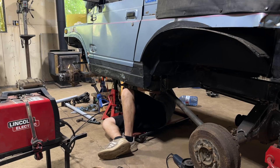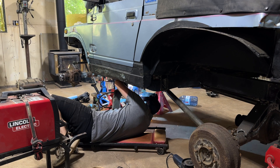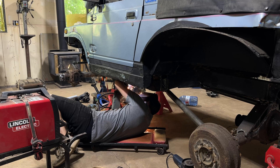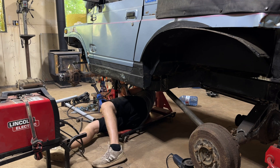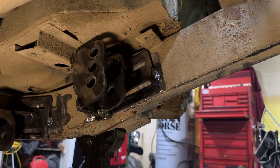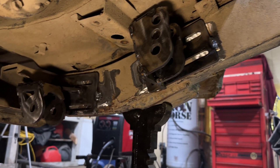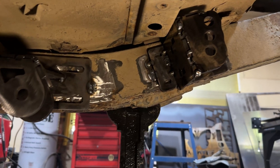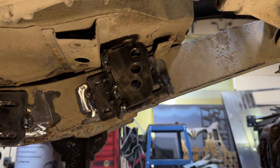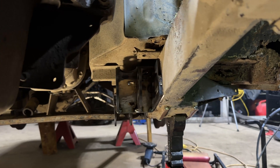My main goal with putting these mounts on is to use the proper length of the links, attach them to the axle housing, and articulate the axle up and down throughout its range of motion. This is what's going to let me know if I have any excessive bump steer when I install my panhard bar, as well as if I collide with anything on the Samurai frame or the engine mounts. I'm welding these mounts directly to the frame right now and I haven't done proper cleanup — that's because this is just a first trial for a proof of concept. I also haven't added any frame stiffeners, which we'll be doing in the future.